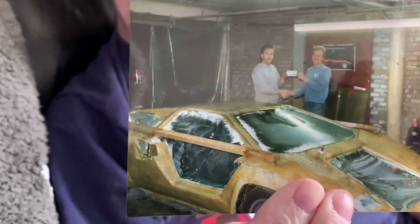It depended on how thick the cars were laminated as to whether they would sag at the front. But because there was a steel framework around there, it lifted it back up anyway, because you sat it on it and then pushed the front down. So when that couldn't drop, the front had to. And the windscreen pillars, as you can see on that, we've actually laminated over the windscreen pillars onto the glass, because we couldn't take the windscreen out.